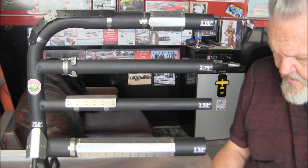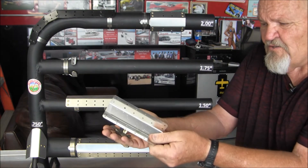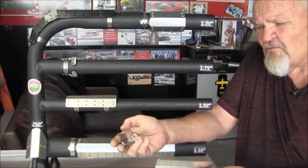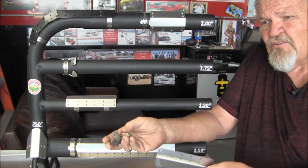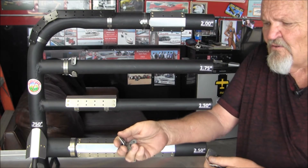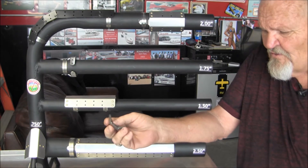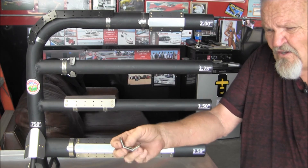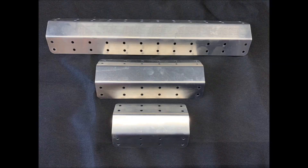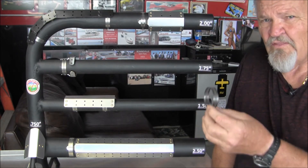We intended the kit to ship with two brackets per aluminum heat shield and the rivets. On the rivets, you can use eighth inch squeeze rivets or eighth inch stainless steel pop rivets with steel pull pins — those work very well and they're really simple. Everybody's got a pop riveter, and a lot of guys who didn't build their airplanes don't have rivet squeezers. When you order on the website, you choose the length of the kit you want and provide the tubing size, and we will ship them with the appropriate clamps.